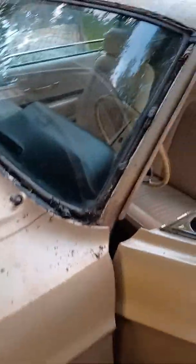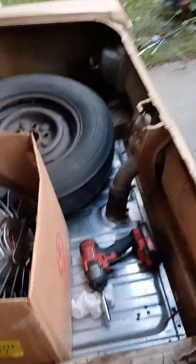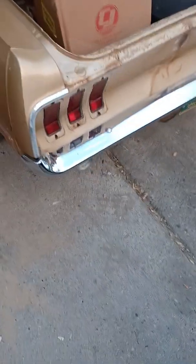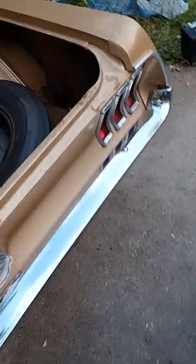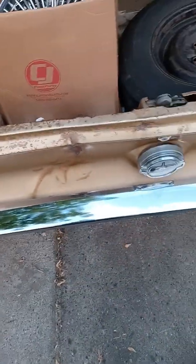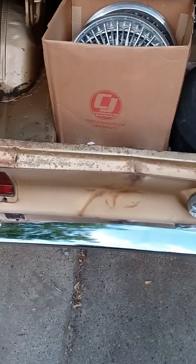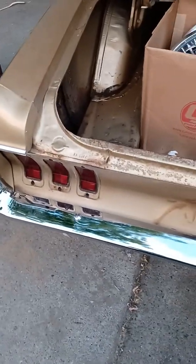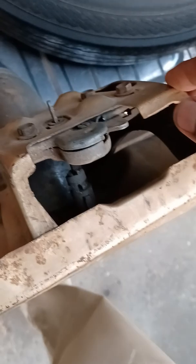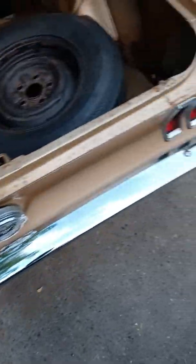So this is the project I'm taking on. Already got the molding around the windshield out — that's got to come out, and so does the rear glass. This is the first day of disassembling, and this is where I'm at. It's in the process of removing the taillights. Got to get the back bumper off as well. I was going to keep the rear taillight panel on here, but as you can see it's got some damage right there, so that's why I'm going to cut that off too. I got to find out where all the spot welds are and get this out without removing this reference piece, so when I line up my new taillight panel, everything goes in well.